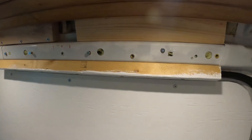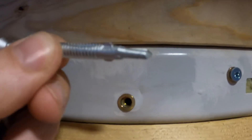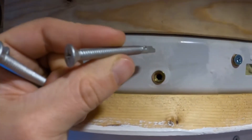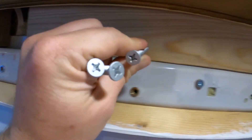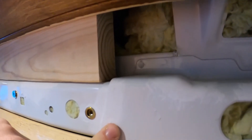It's going to have a lot of things supporting it in a lot of ways because it has to hold up my whole weight. I attached it using these wingtipped Phillips metal screws. Those little wings right before the tip of the screw — that's so when it drills through the wood, it creates a hole that's big enough that the teeth don't grab. The actual screw part doesn't grab. So whenever it's hitting the metal and spinning, it's not trying to grab the wood. It's just spinning as much as it needs to, and then the head is what actually holds it in place. The metal behind this piece of wood is pretty thick, so it holds better with a metal screw than a lot of the other metal in the van.